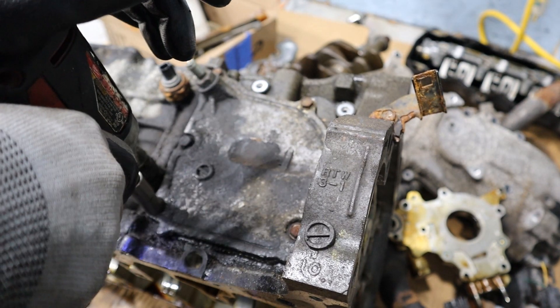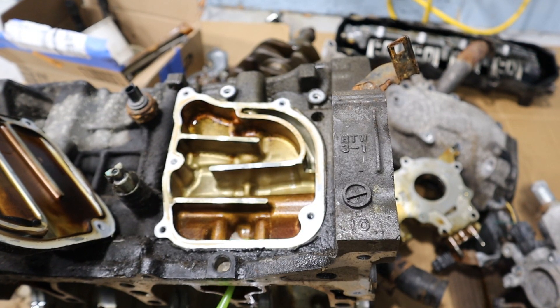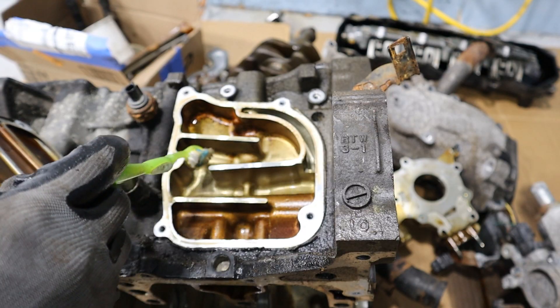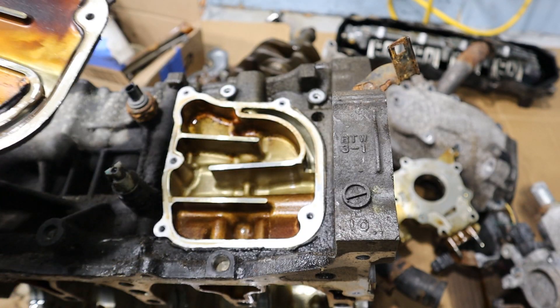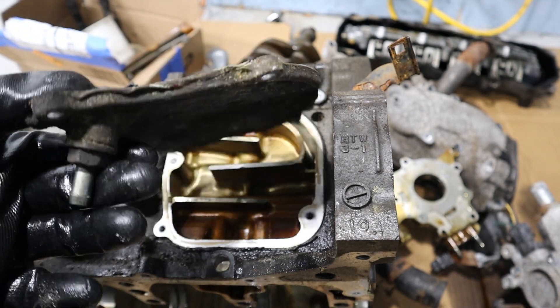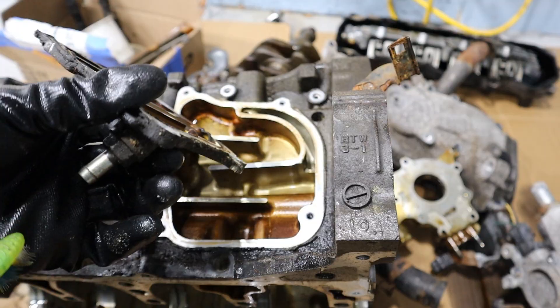The PCV system is integrated in the block just behind the starter — this is the PCV valve. Oily air comes up from the crankcase as those pistons move up and down and is passed through this baffle system, hopefully allowing the oil to settle and drain back down into the sump — though usually that doesn't happen. Then it exits through the PCV system, which has a little check ball inside that hopefully does not allow oily air to enter the intake, though often it does.